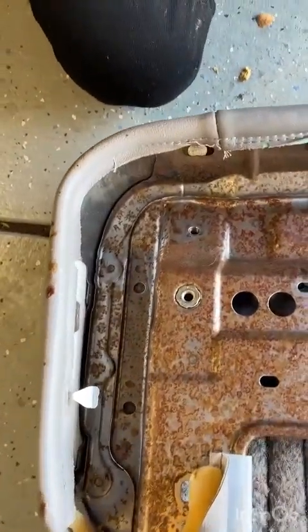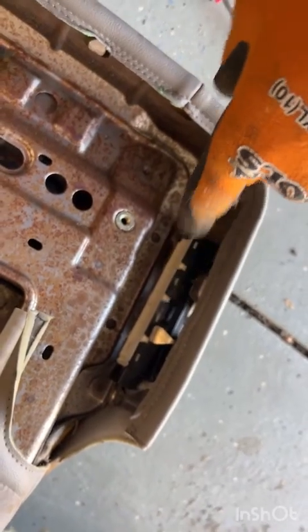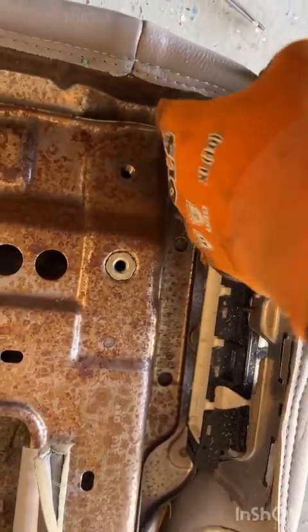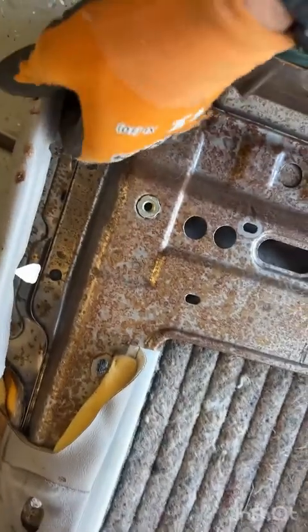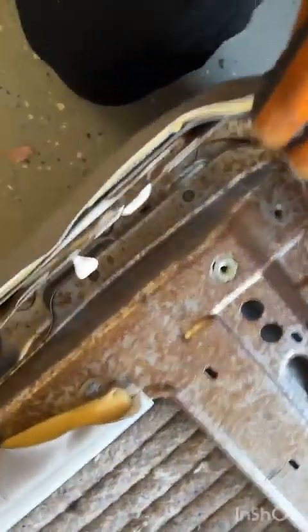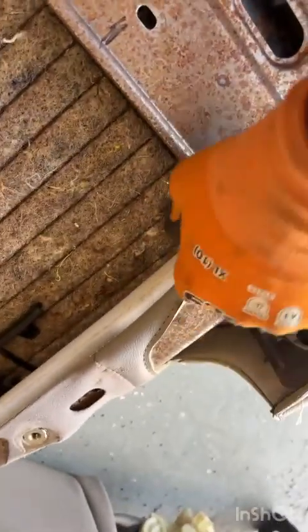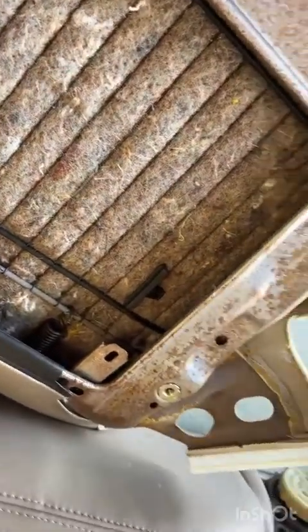All right. With all of our 1, 2, 3, 4, 5, because remember there's one under there, 6 tabs carefully folded down, you can take the front of the seat and just peel it outwards towards you. Again, super hard to do one-handed. So it'll be much easier for you after you watch this video, or while you're watching this video, to do it yourself. Oh yeah, get it. All right, front's released. These guys, it's a little easier to peel from one end, I found. Pull it towards you this way, and then you can just peel it right off.